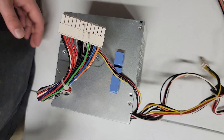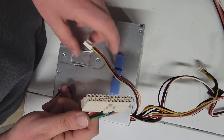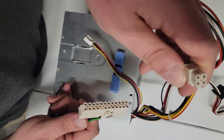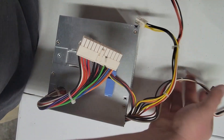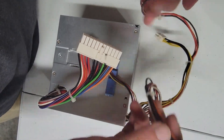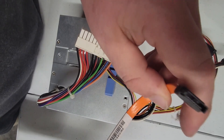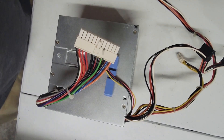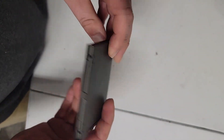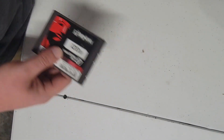The first thing I'm going to go over is your power supply. As the name says, it supplies your computer with power. You have a 24-pin power cable that's going to supply your motherboard with power, and then you have a 4-pin that is going to supply your CPU. These right here with the little L's in them are SATA power, and it comes with several of those — you need those for your hard drives. Then there's a SATA data cord which will look like this orange one; notice it's got a little L in there. We're also starting to go to SSDs or NVMe drives.